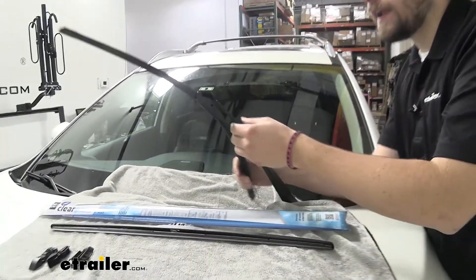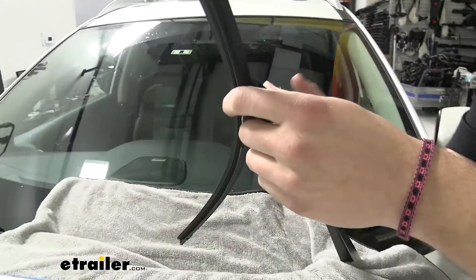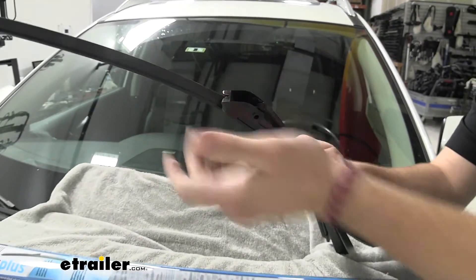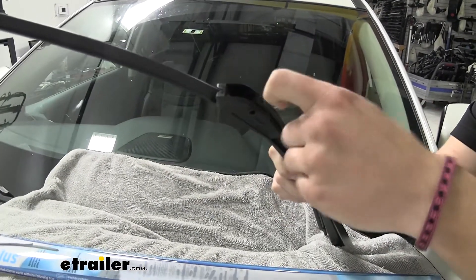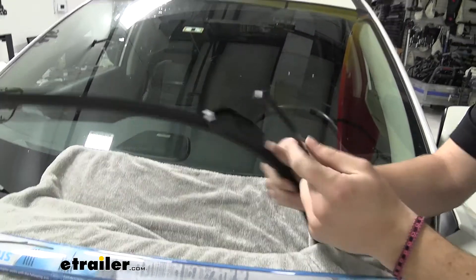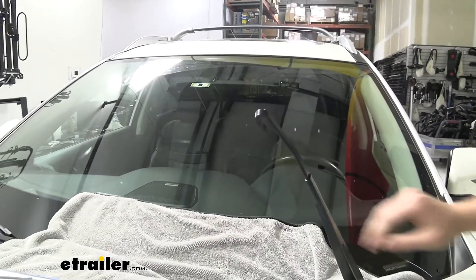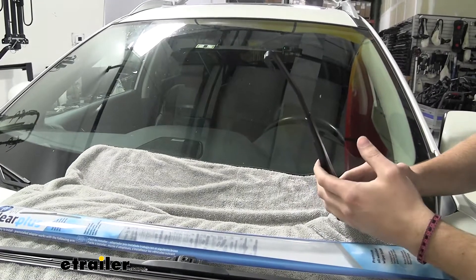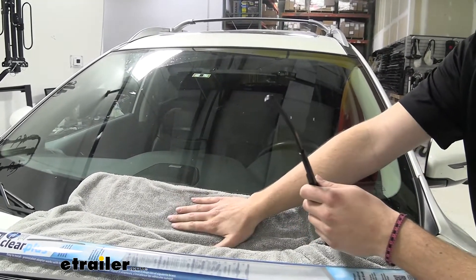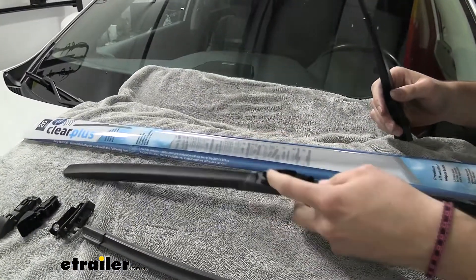It's going to be really easy to take this one off. Keep in mind, when you want to take them off, there are usually a couple tabs to push to make the takedown a little bit easier. However, with these today, all we have to do is get out of the hook. We have a little J-hook, so we want to go ahead and pull it out like so — it's going to clear quite easily. Now, the reason we have a towel here today is that this is spring-loaded. If you bump into it, it's going to crack down, so we want to protect our windshield. We've thrown a towel in here to install our new blade.